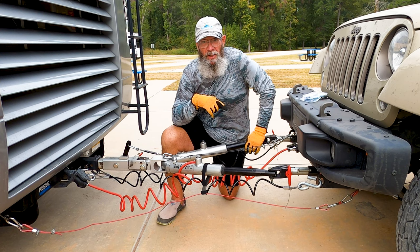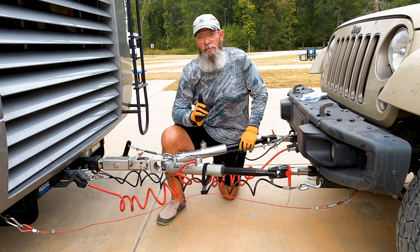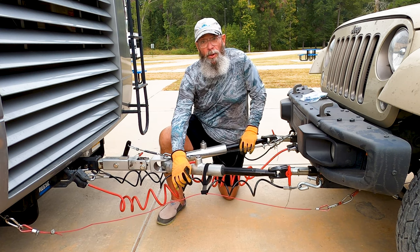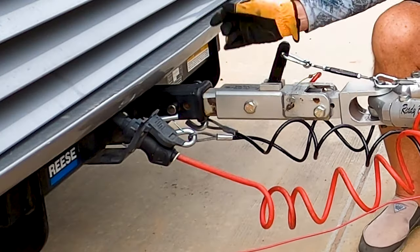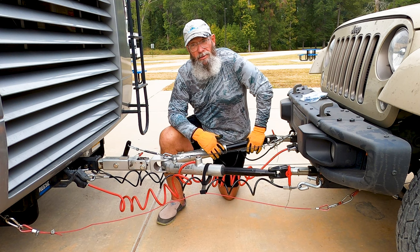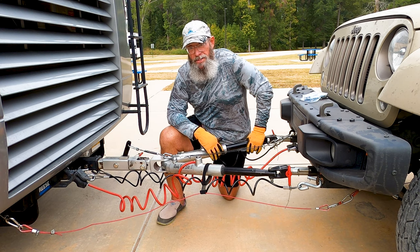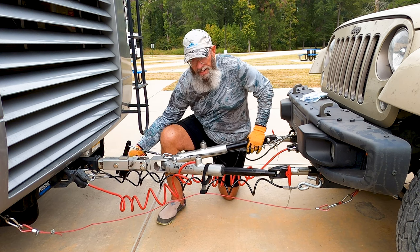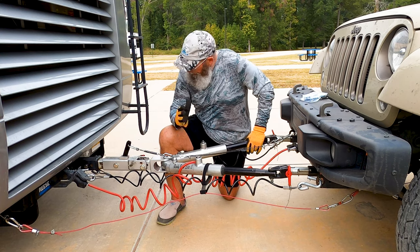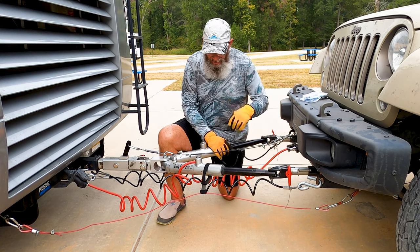After watching the first part of this video, Randall with NSA Products gave me a couple of tips. First, he reminded me that your safety chain — or in this case the coiled cable — must be crossed when you attach it to your towing vehicle. A truck driving buddy of mine, James, would remind you that is state law in most states. You have to cross these; it adds stability and may keep your tongue up off the pavement. So cross your safety cables.